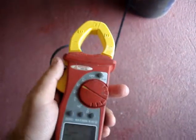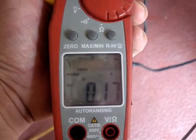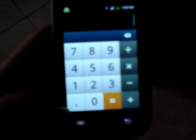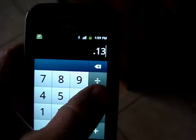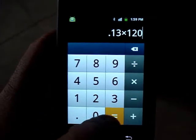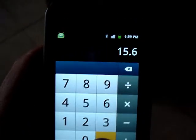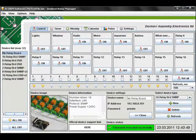It plugs right into the LPT port. Now one of my major concerns with this was the added wattage that was going to be taken up by running this computer. So what I did was I plugged it in, got both the operating systems running, and found out how many amps that was. I multiplied that times 120, the household current, to give me my watts. I came up with 15.6 watts, which isn't too bad. I can offset that no problem.